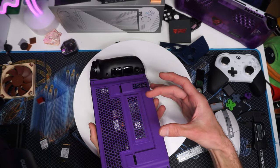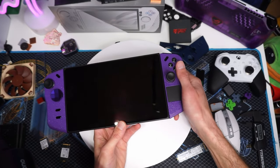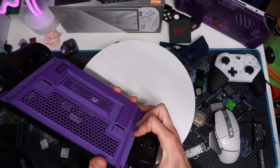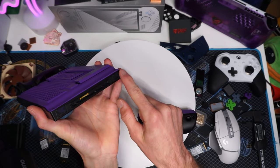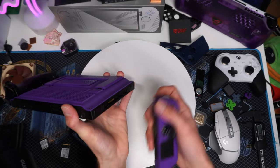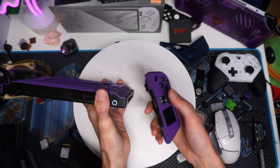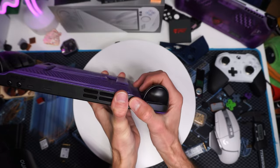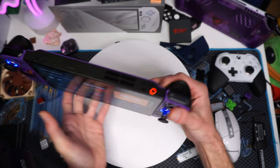You can also buy an NVMe that actually has a heat sink already fixed to it, which is even better. Now, one of the other things I quickly noticed — this happens with the stock joysticks or controllers as well — you'll get some wobble where the controller wobbles on the housing. There's a quick and easy fix for that. All I did was take a spare skin kit that I had and cut a piece and paste it here, cut a piece and paste it there. This was part of a Dbrand skin and it basically bridges the gap between the housing and the controller housing because there's just so much room between them it starts to wobble. I've seen some people use a paper towel and other weird methods, but those are only going to last so long, especially if you're moving your controllers in and out. This is a permanent solution and it doesn't wobble anymore — it's very firm and it still allows me to take it in and out of the housing just fine.